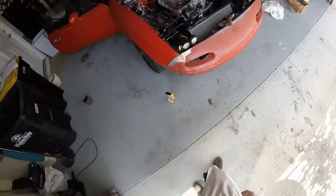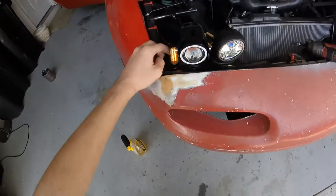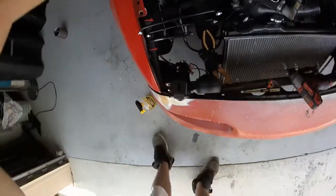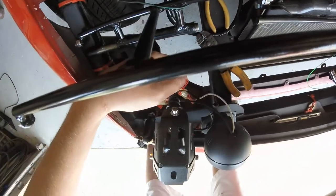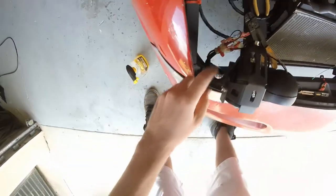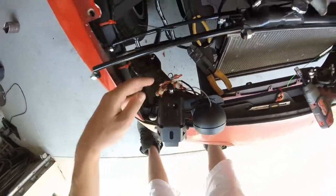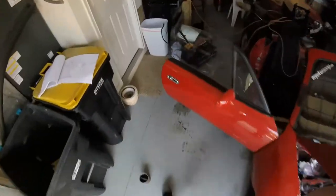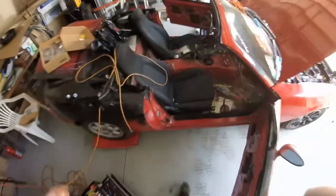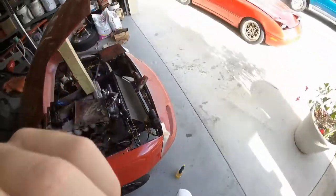So I ended up fixing this side. Really all it was was a loose connector — one of these things back behind here actually fell off. These wires are so thin for these little turn signals because they're just cheap eBay crappy garbage motorcycle turn signals. The wire is so thin that the crimp-on connector couldn't actually crimp onto it, and it ended up slipping out.